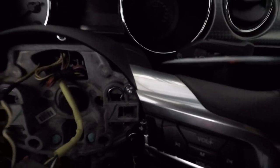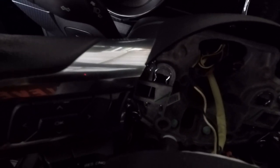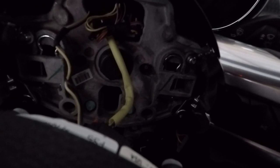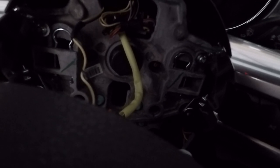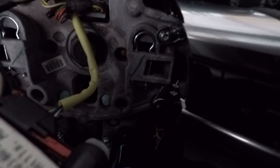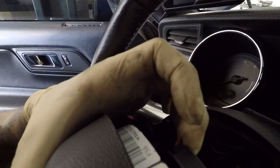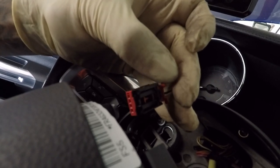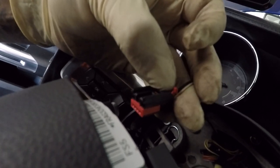What you're doing is putting your pick in from the side — you can see the pick coming in down here — and you're poking this little arm right here. You want to push this arm over to the side. Right there, you can see I'm pushing this little arm to the side so that the clip on the bag releases. Once you've got that, you're going to have a few connections to remove. This top one here — you slide the clip up, push the little pin down, and then pull it out.